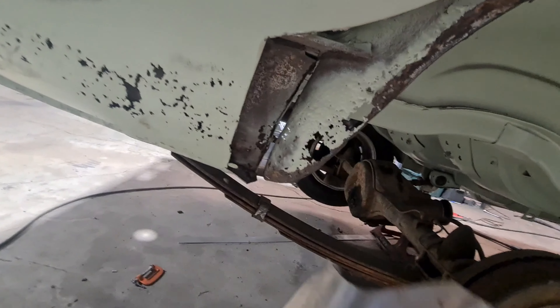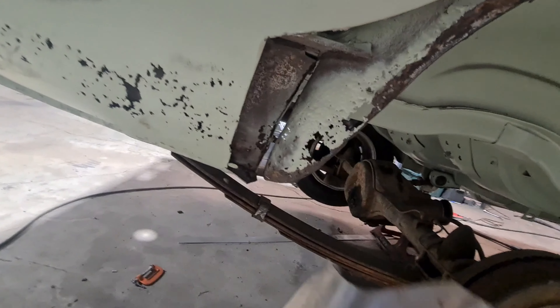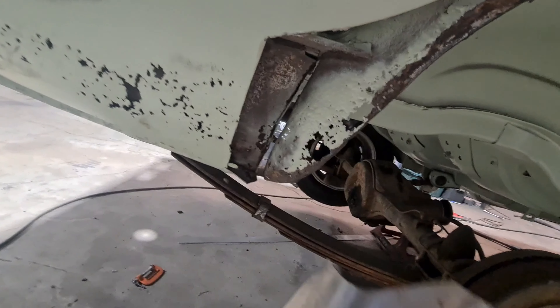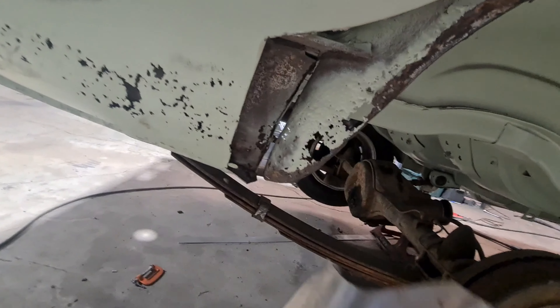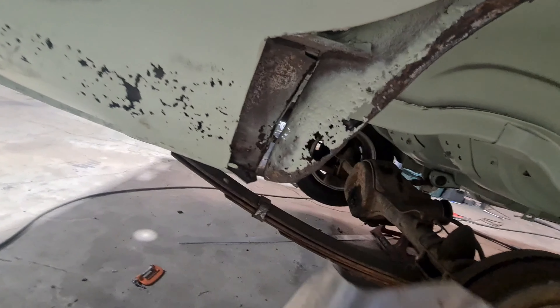Flipped it back over and deciding how far up I want to do the skin. It's a bit torn and cracked up near this body line anyway — there's a dent and a few other wax marks — so I'm almost thinking just go right up to the body line and sort all that out at the same time. Makes no difference if you're joining here or here, it's the exact same amount of welding, so you may as well make it nice. These door skins are fairly simple — there's only curvature one way. I put it in the slip rollers to gain the curve I need, clamped it to the door, scribed my lines, trimmed it back for the folds, and put the bottom fold in the press brake to keep it long and straight.